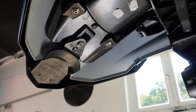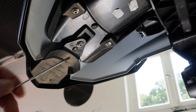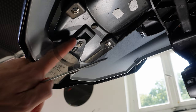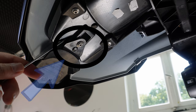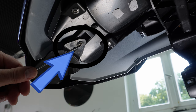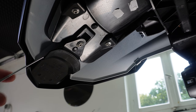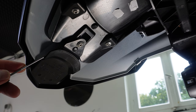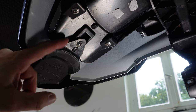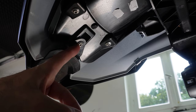A small but important tip when remounting the beak: looking at the underside at the three front screws, there is a triangular black tab that needs to be mounted from the underside. It is possible for this tab to slide underneath a housing incorrectly. When putting the beak back on, check underneath to make sure the tab is on the bottom side so you can mount the screw correctly.